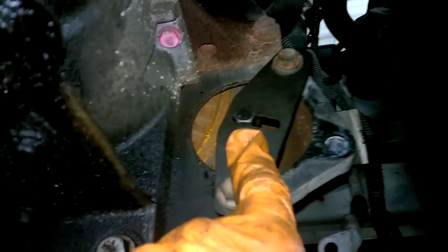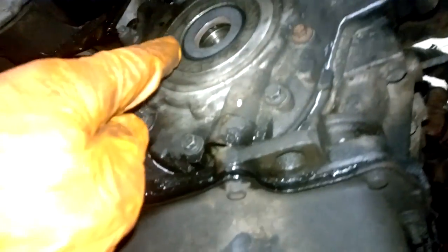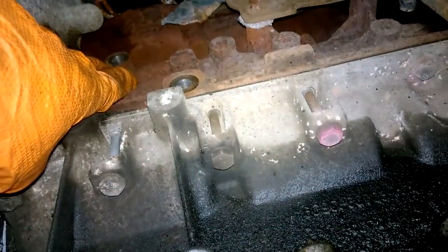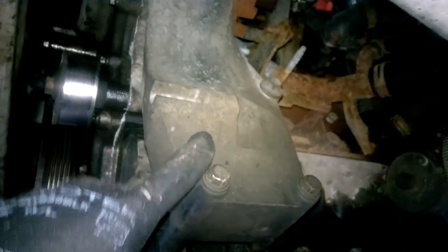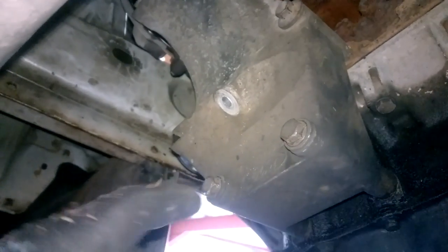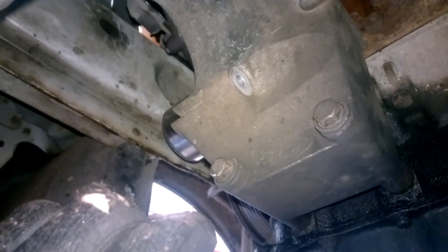Now it's time to remove the flywheel locker — this is the tool here that locks in against the teeth. I'll be loosening those two bolts and taking it out. When putting in the crankshaft pulley, remember to have the plate at the top and your locking pin lobe removed. The starter is now back up in place. Next I'll be putting up the alternator — the bracket is returned, and it's behind that bracket that the locking pin for the crankshaft sits, held in by a blanker bolt that winds out so the pin can go in after.